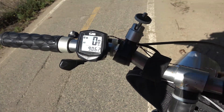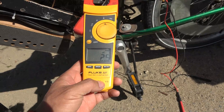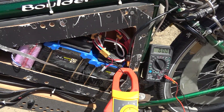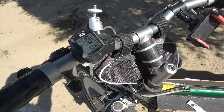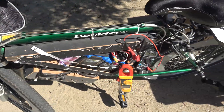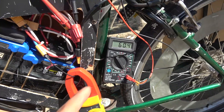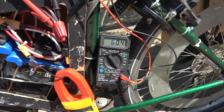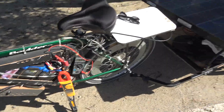I've gone about 9 miles. It's charging my battery at two and a half amps — that's about 150 watts. Usually at 9 miles my battery is almost dead because the range is only 11 miles. But check out the battery voltage right now: 60.4 volts — that's almost full. I didn't expect that.